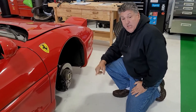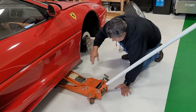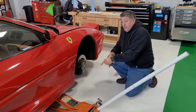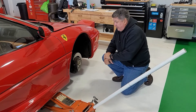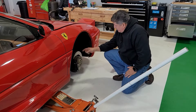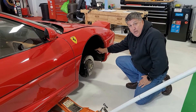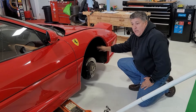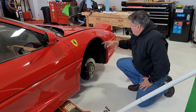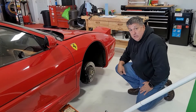First thing we did is jack up the car. I've got a fitting in here — it's actually one made for BMW that jacks the car very nicely. It fits right in the little slots for the Ferrari 355. Took the wheel off. Next thing we're going to plan on doing is removing this — it's the battery tray and that's a cover for the battery. The battery is underneath it. We should be able to remove that battery, and there's a brake that we'll take off, then we should have access to that motor.